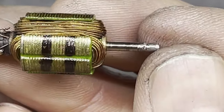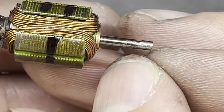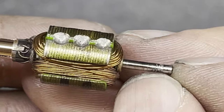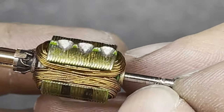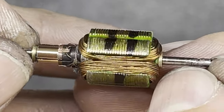Also the other end of the armature shaft has been ground away horribly, but I think there is enough shaft to put the pinion on properly when I've spaced the armature correctly in the setup — so the pinion goes over that rough edge and sits nicely on the part of the shaft that is still quite good. So I think the armature is salvageable.